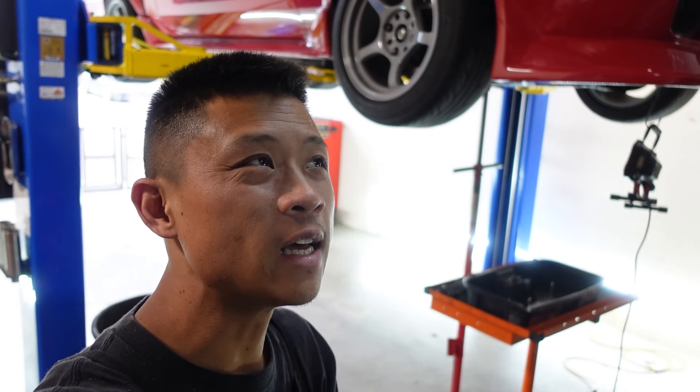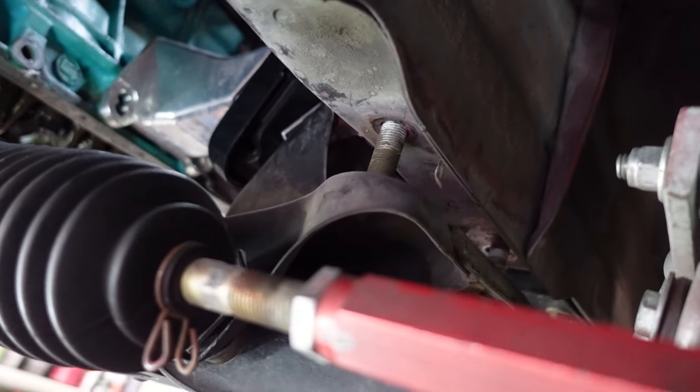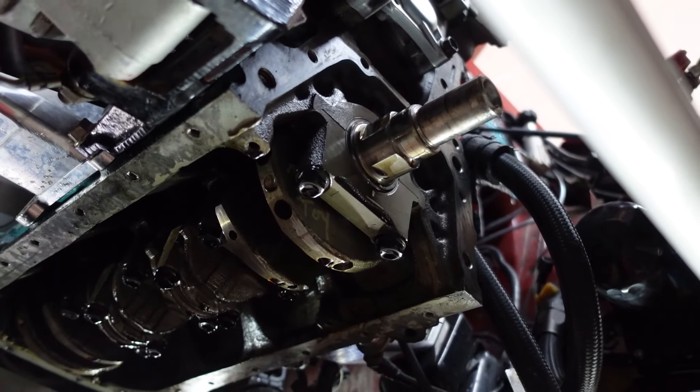Another small update. It's usually better if you set a goal for yourself to achieve by the end of the day. Today's goal: resealing the oil pan and then also getting the oil pump on. This J160 swap plus the JSP mounts and the Cusco mounts means the engine sits very close to the subframe. Normally when you reseal the oil pan, you shouldn't need to unbolt the engine mounts or anything — you can just take the pan off. But in this case I had to do some stuff. I have an engine hanger hanging the top of the engine by the two engine mount hooks, and a pole jack supporting the trans. I basically just lowered the subframe — keep the engine in the same spot but lower the subframe — and that gives me a ton more clearance to take the pickup, windage tray, and oil pan off. Also, oil pan's got to come off to replace the oil pump too.